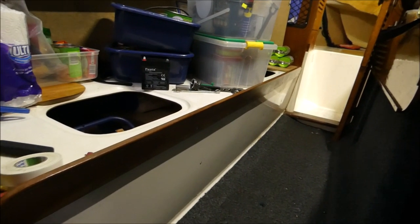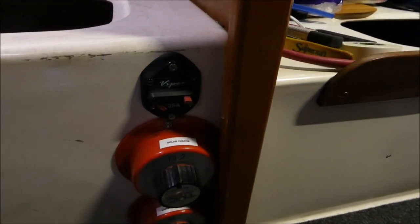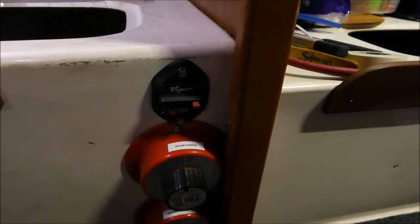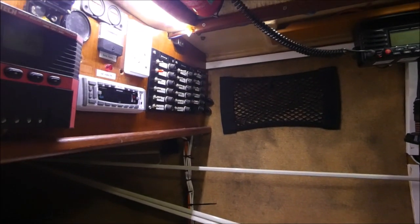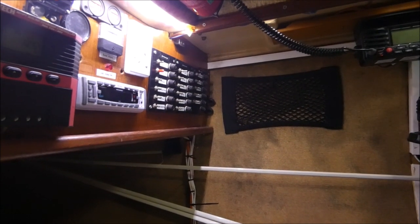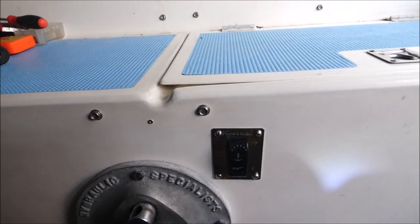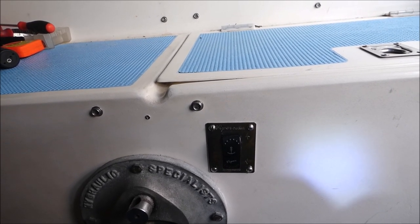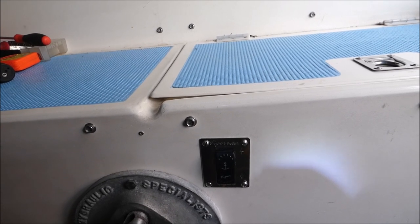After finding a path through all the seat lockers through the boat for the main cables and control cables, I located the anchor winch circuit breaker close to the door but just inside the boat where it can't be knocked easily. It controls both the anchor winch itself and the relay control system. The relay control system is also run through fuses on the switch panels so they can be turned off independently and have a fuse should there be a short in the system, so they won't cause a fire. The control cables also run through the lockers outside to a conveniently located anchor switch at the back of the boat, so that when approaching an anchorage — especially when sailing solo — I can lower the anchor while still in control of the boat, or raise the anchor and motor straight off from the anchorage on a windy day or in a tight anchorage.